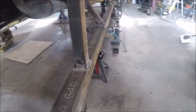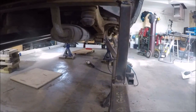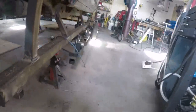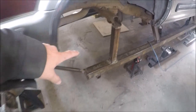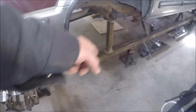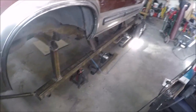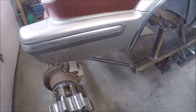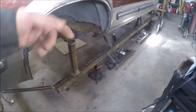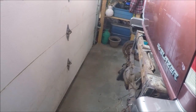There might be some twist yet in this frame, so I'm going to jack up the vehicle and get this side up higher. Once it's up higher I can fit the wheels back on and then put the track on and tighten up the lugs. Once I get the track on and the front wheel on, I'm going to put the battery in, start it up, and let it idle. I'll probably put the track on, size it, cut it, do the final assembly, then start it up, let it idle, put it in gear, and see what happens.